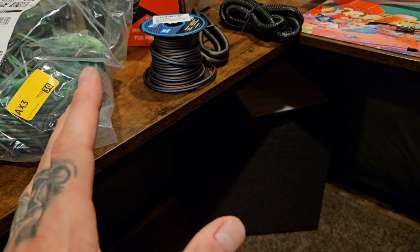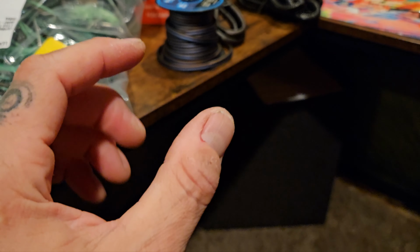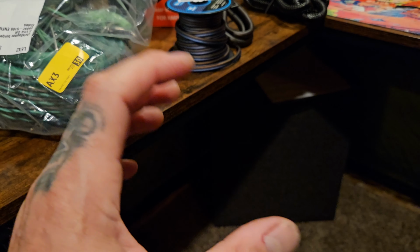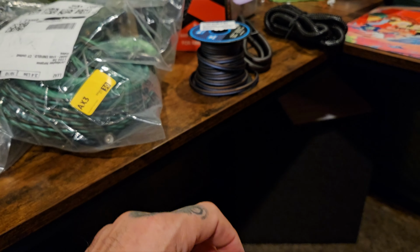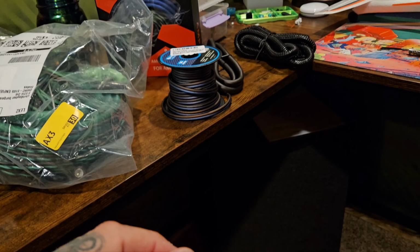If you're new to all of this, that means component, that the tweeter that gives you that high pitch and the chimey sound is actually separate from the woofer. So that's way up in the pillar, and then the driver or the woofer is in the door. The rear coaxials, like this. See how these are separate? You could sort of call that a component set.